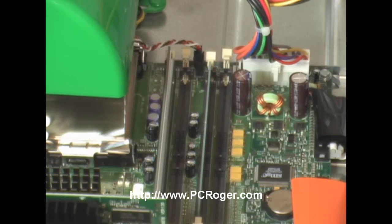What I'm going to do is take the memory that's in here — since it's a lower quantity, 256 versus 512 — and actually move it to the second bank. Not really necessary. There were some machines years back where if you had faster or slower speed memory, you'd have to put it in differently so the machine wouldn't try to perform at a higher level than the memory is capable of. This is just what I like to do. I'll be putting the 512 in the primary bank and the 256 in the second bank.